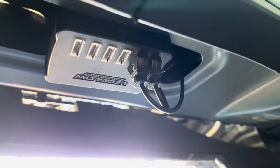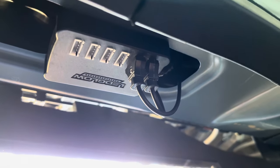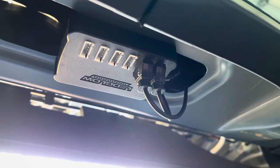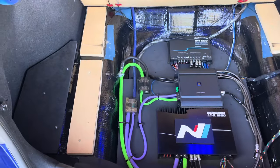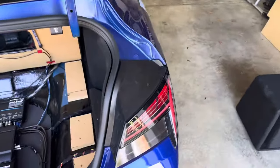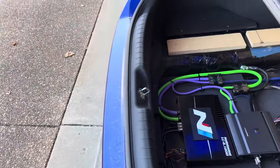I installed LED lights on the underside of the wood panel around the Lexan window and on the rear deck of the trunk. This really lights up the whole trunk from below and above. I mounted the LED tube's control box on the underside of the rear deck, hidden by the subwoofer, giving me quick access to the wires if needed. The LEDs came with a remote control to change color or movement. The trunk is completely sound-deadened throughout the bottom section, trunk cover, taillights, and rear deck both top and bottom. This helps to reduce rattles and increase bass inside the car.